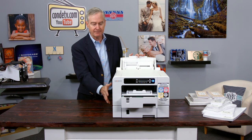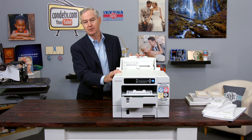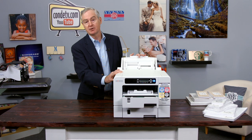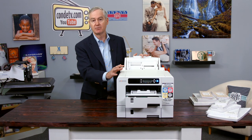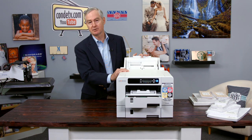In addition, after you've installed all the trays or any optional accessories, you must cycle power on the printer for the printer to see the new accessory. And it's as simple as pushing the blue button until the printer turns off, turning it back on, and you can run that list test report again. And this time, if you were to run it, you would see that we have a bypass tray and the bottom tray installed on our printer.